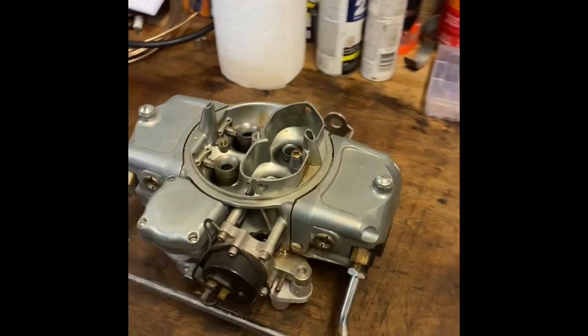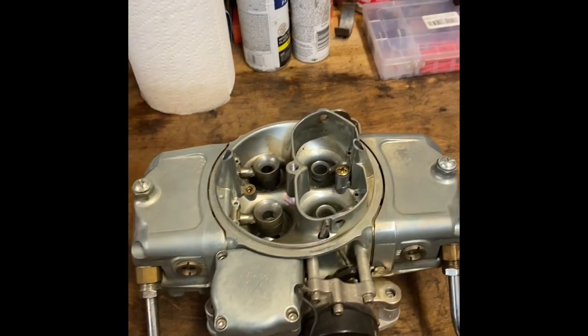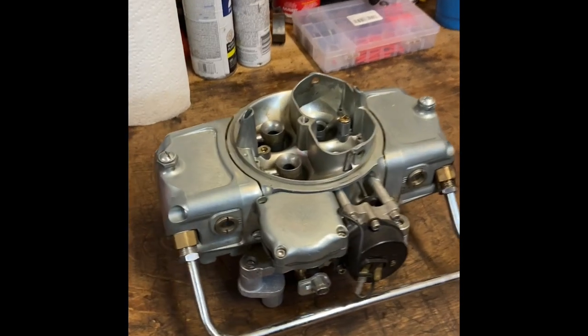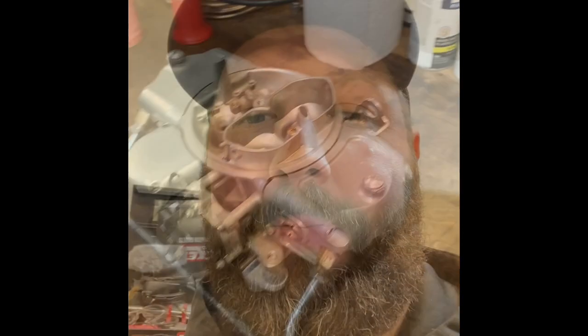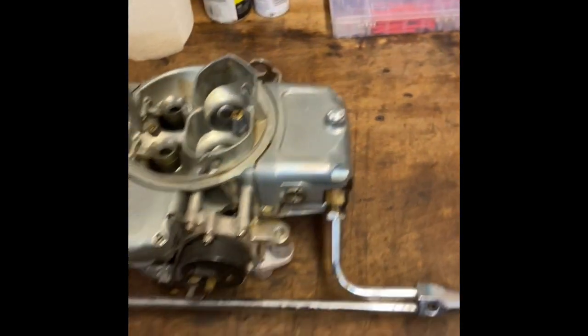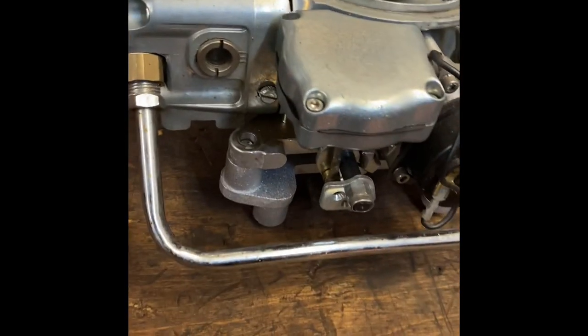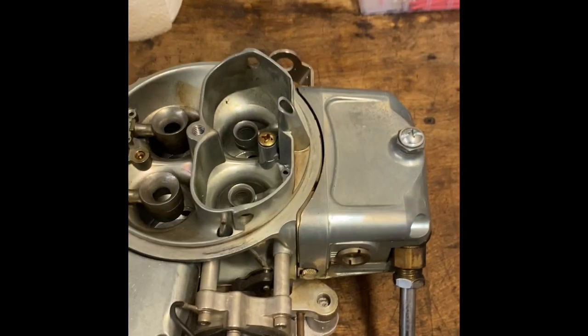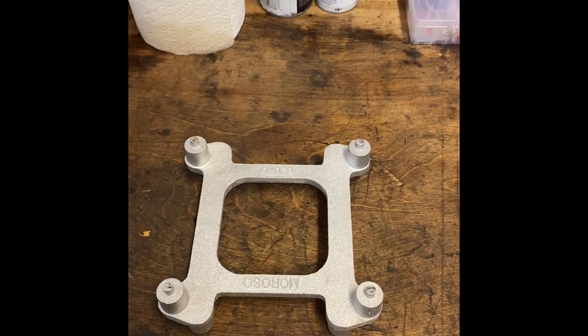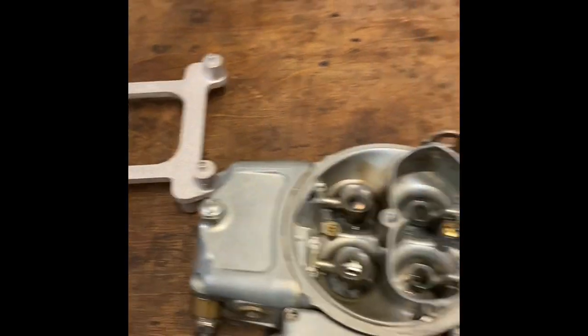Let's talk about carburetors — it's the little box on the engine that meters the fuel and air. Some of you young guys probably don't know anything about this. It's actually a free carburetor, surprisingly — Demon 650. It's the wrong carburetor for the job; I really need a 750 for this engine. A 350 spinning 5,500 RPMs would not normally need a 750 CFM carb, but I've got a blower. So this is going to be our limiting factor, but that's okay because it was free. It's dual feed, vacuum secondary, with metering blocks on the primary and the secondary. Get yourself one of these carb stands, because if you don't, it won't sit flat — as demonstrated here.